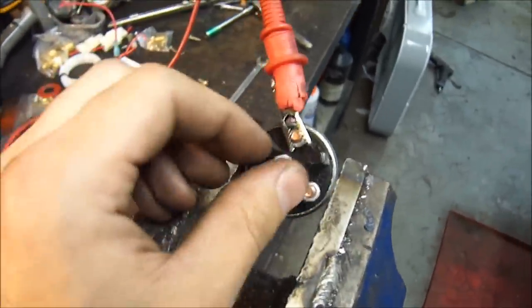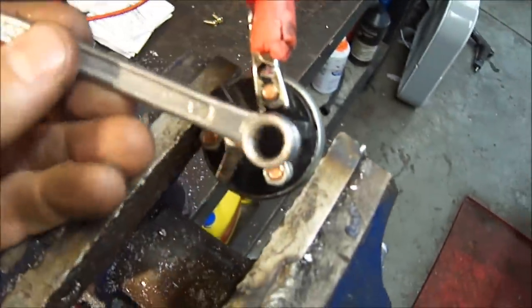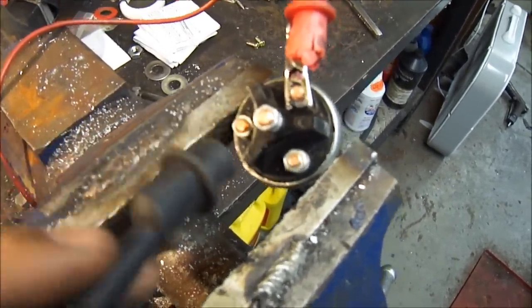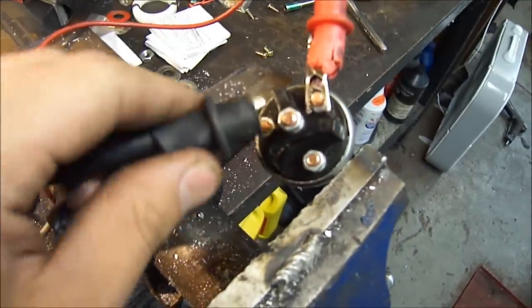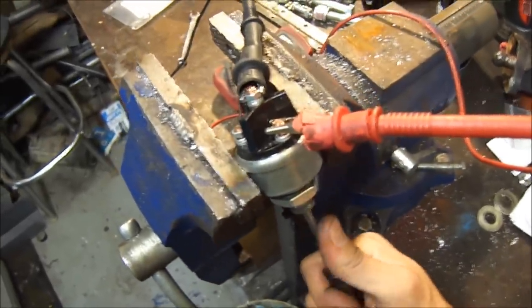So I'd have my wires on there, then I'd pull the switch off and test it — everything's working right. I hook my start wire back up and snug it down with my fingers: no power to start, power to ignition, power to accessories. Then I put a wrench on it — not cranking it down hard — just tighten it up snug. Still in the on position: power there, power to ignition, but no power to accessories. So I have power at the start right now and I shouldn't. If I hook this on here, the meter beeps. Turn it all the way where it should start — it goes off. Let go — power. So that's the opposite of what it should be doing.